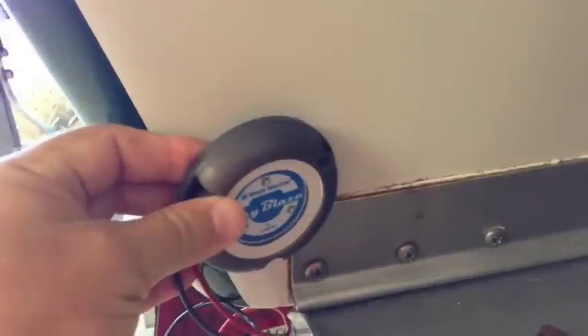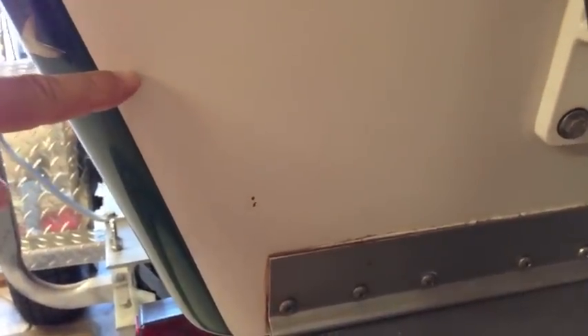This is an inside look. The other thing I want to be careful of is I don't puncture that hydraulic line or snag any of these wires. I've got my spot marked where I'm going to drill. I raised it slightly because I ran into the risk of the edge of the light hitting the edge of this bracket, so I moved it up just slightly to compensate. I want to keep it as low to the water as I can get — you can see this mark right here is about where my water line is, so I'm certainly under water.